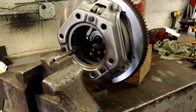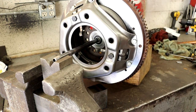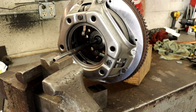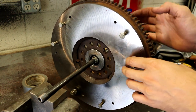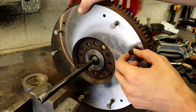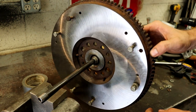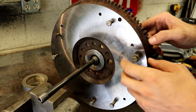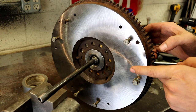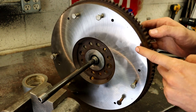Here I'm giving the flywheel a spin on the shaft and then marking the point where it settles each time to see if there's a heavy spot. It definitely had one, so I wanted to make some attempt to balance this before putting it back on the engine. I took off the pressure plate just to check the balance of the flywheel itself, and it seemed like the flywheel itself had the heavy spot on one side. To try to balance it, I added a couple of washers to the lighter side of the flywheel. Now it is so close — I think this is pretty much as perfect as I'm going to get with this sort of setup.